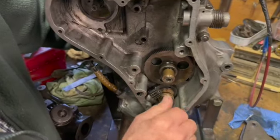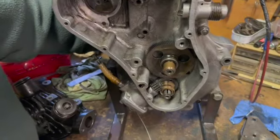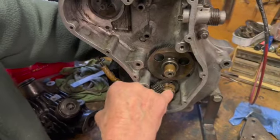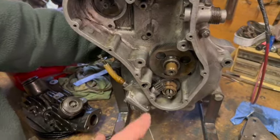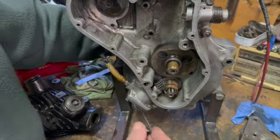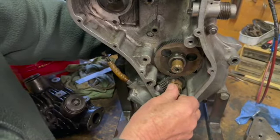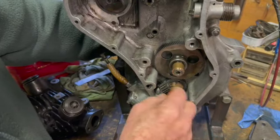On the end of the crankshaft there, they've got a keyway, which is not really used with the key as such. That's for the tongue on a special washer that goes behind this nut. It's got a little tongue that hangs down in that groove. And because this is a left-hand nut, once you nip that up onto that washer, the washer can't move, so the nut won't move.